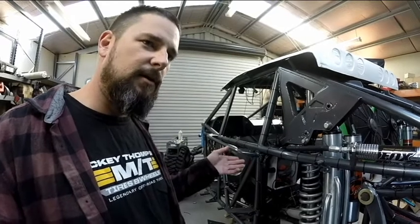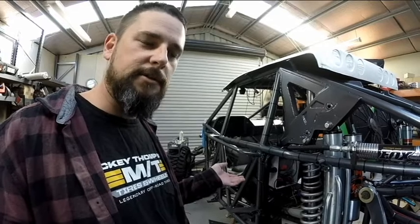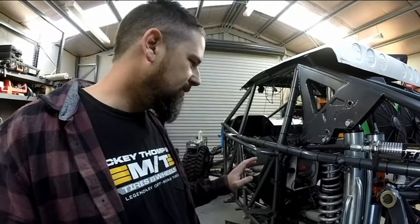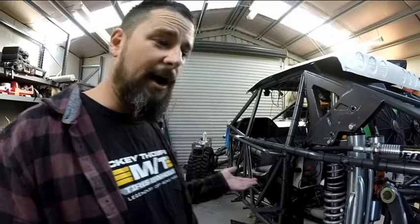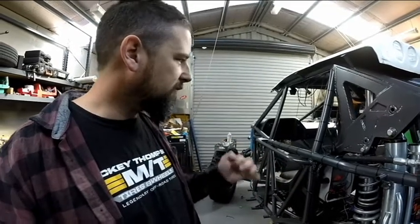And the other thing that I didn't do was I wired the car first, and then I planned to program it later based on how I wired it. And then the problem was when I put power onto the system, straight away the engine started to try and start, like the starter motor was active and all sorts of things. I had kind of identified that could be a possible problem, so I was ready on the kill switch, and I killed the power straight away.